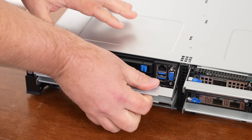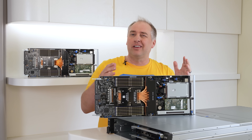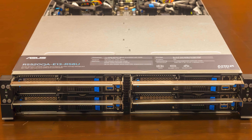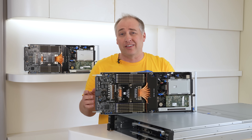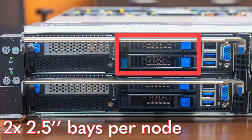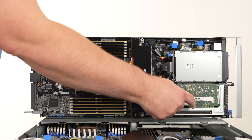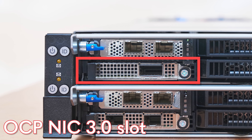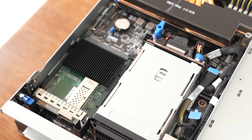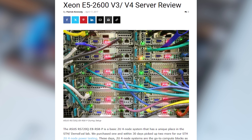Let's get inside one of the nodes and talk about the cool features. Starting at the front of the server, we have something a little different than a lot of other 2U four-node servers. We have front IO plus storage. We need expansion slots too — a lot of times you have storage on one end and expansion slots on the other, but not here. We have two 2.5-inch storage bays, then two network card slots — a PCIe low-profile expansion slot and an OCP-NIC 3.0 slot. Just behind that area is our PCIe cables and postcode LED. ASUS used to have the postcode LED on the front or back, but now it's inside — at least you can tell if something is wrong.